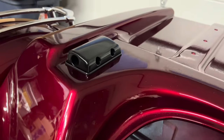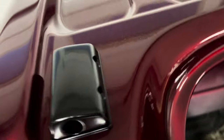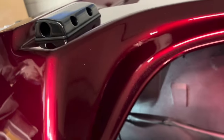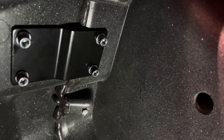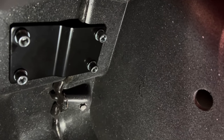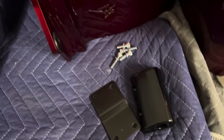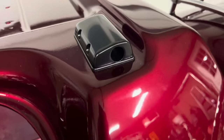Okay, got the right side block already installed. There is an orientation on these — you can see it's solid on the outside, and the two bolts that hold the arms will be on the inside facing in. Underneath, there's the plate; in the back are the longer bolts, and the shorter bolts are in the front. These get torqued to 120 inch-pounds — inch-pounds, not foot-pounds. Do the exact same thing for this side, and don't forget your best friend: gotta use some Loctite.